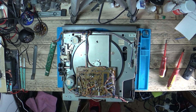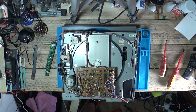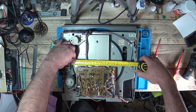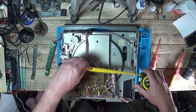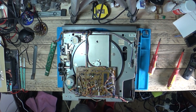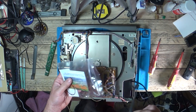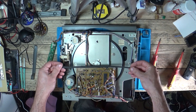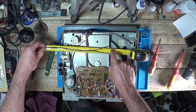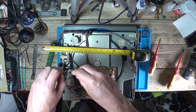If it was that easy I'm sure many other people would change the belt on these. So let's measure the platter for Mahinder. Measuring across there, that is 228mm. Let's get this belt out and measure it - see if it is 25 inches. It's folded in half, so that should be 12 and a half inches. Resting it on there - yeah, that is pretty much 12 and a half inches. So we know we've got the right size.